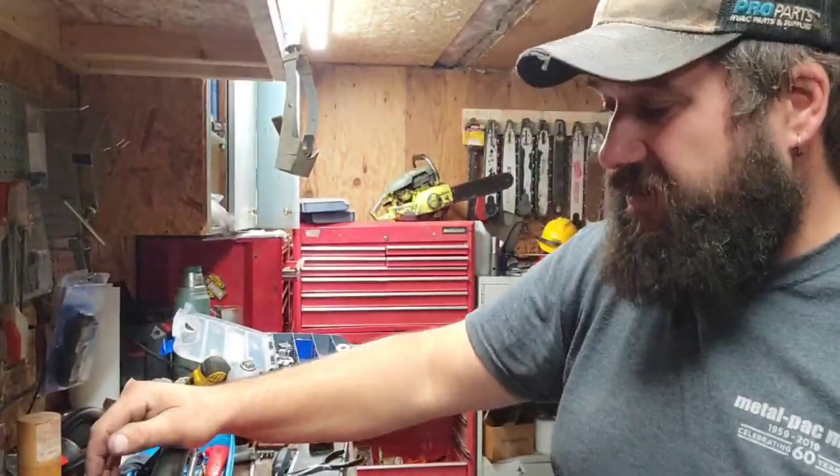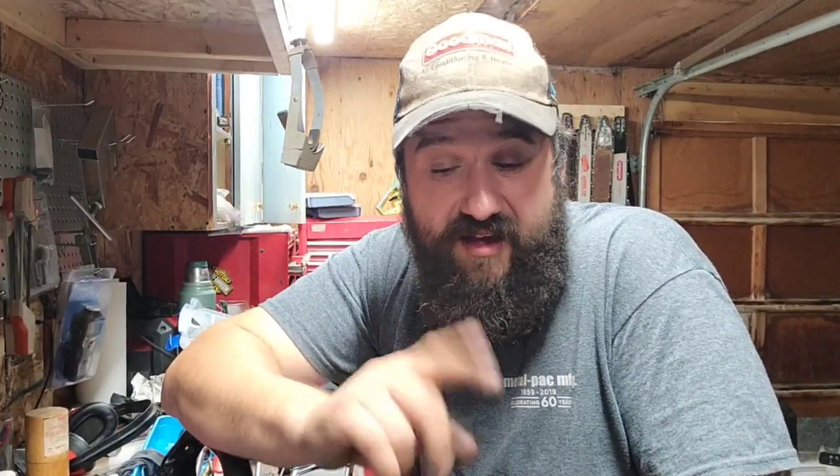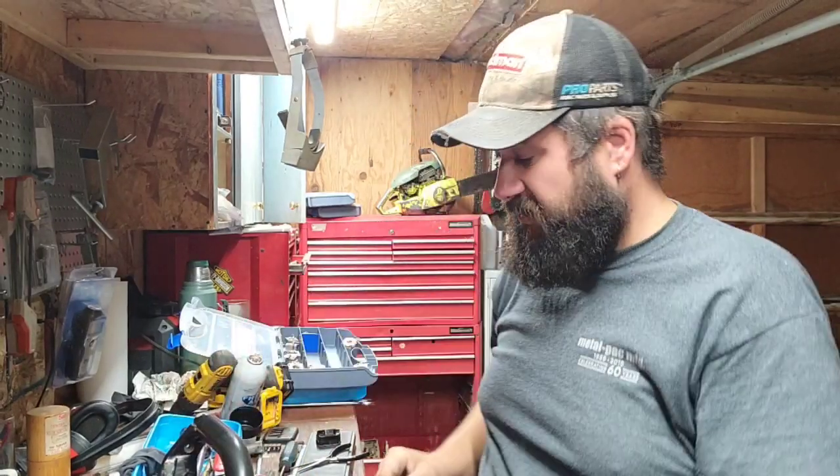The 130 Super that we ported is still on the bench. This is the fun — I made it run. I haven't shown you guys it run yet. It doesn't run well. It's hard to start. It's super rich. It's spitting fuel through the carb. It's got fuel coming out the exhaust. It's not worthy of wood yet, it's not worthy of anything. It runs good though — you pull the throttle on this thing and it's bouncing off the governor on the carb faster than you can even prepare for it.